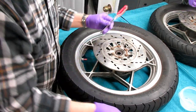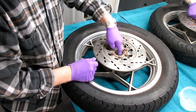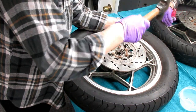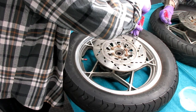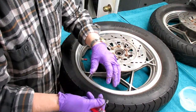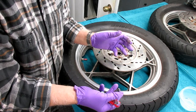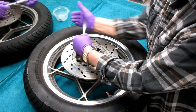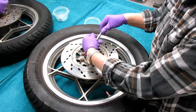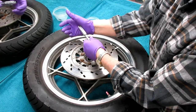The first step is obviously to get the disc off. We're going to rejuvenate the disc or use the other one, re-grease the bearings — these feel real nice — get rid of the weight, and one by one there are steps. It's a long journey, but if you do it step by step there are a lot of ways to do this. It's a little labor-intensive, a little time-consuming, but when you're done the product is well worth the work. These old-school bolts have a little retainer so the bolts don't loosen. In the old days the Japanese engineers used these to avoid loctiting the bolts, because if you strip the bolt that's a big problem.